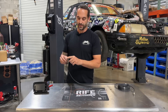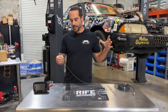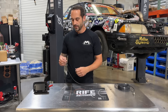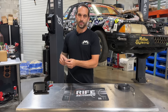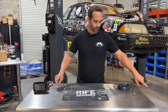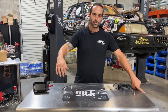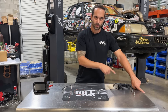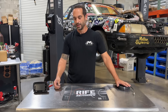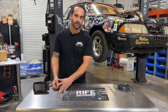It's protecting from stuff maybe coming from outside, but if it doesn't have a place to ground that voltage, it can still get into the wire. Now it's important to note that you only ground the ECU side — you do not ground the other side of the wire. If you end up grounding both sides of the shield, you'll actually create a ground loop, and other circuits draining into chassis ground will come into this wire, actually creating noise instead of eliminating it. So it's important: we're going to ground it at the ECU side of the circuit.